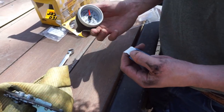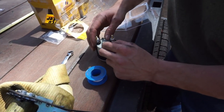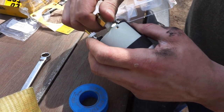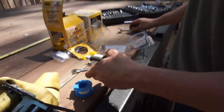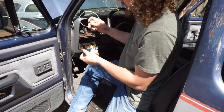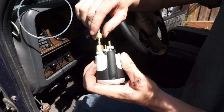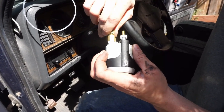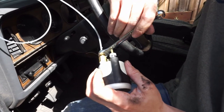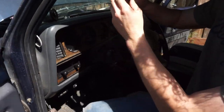And before we worry about the line, we're going to prep the gauge with a little Teflon tape. Good enough for my subscribers. Then we just thread this guy - half inch. It doesn't have to be crazy tight. Now we resume - push the line in, get the bushing in, behind it all is the female. Screw the female on and take our handy dandy three-eighths. Remember, you don't have to do these too tight. That's probably plenty right there. And there's a boost gauge - fire it up.